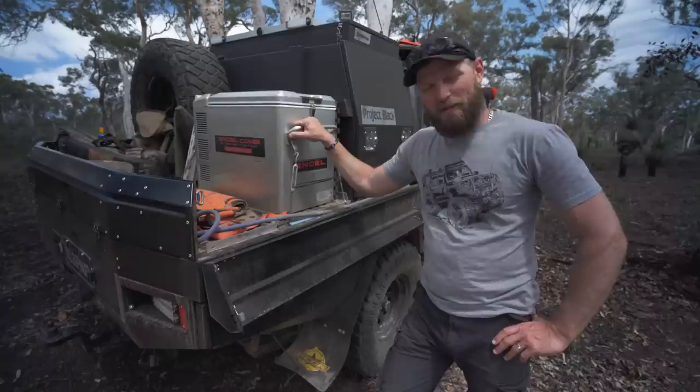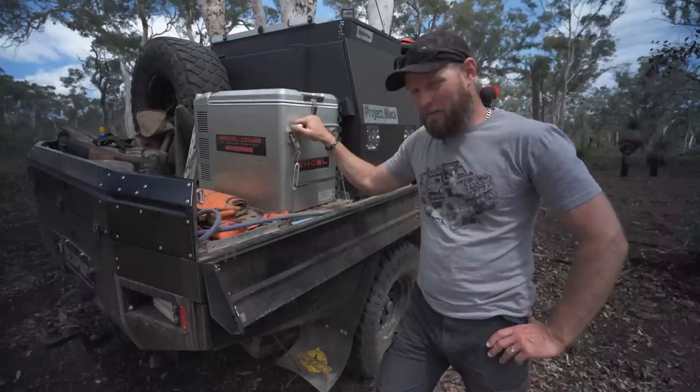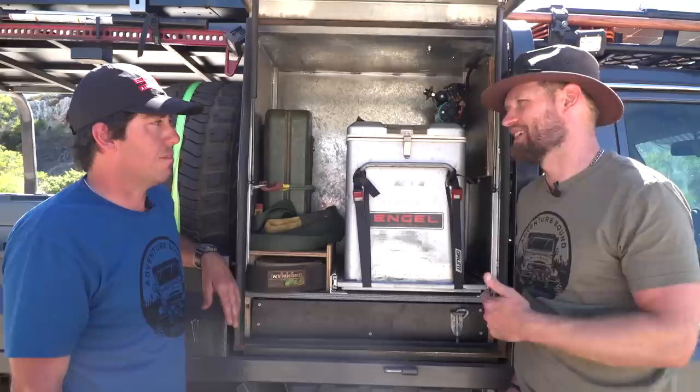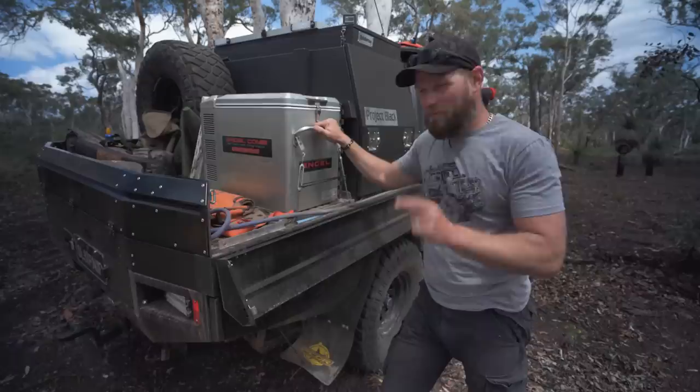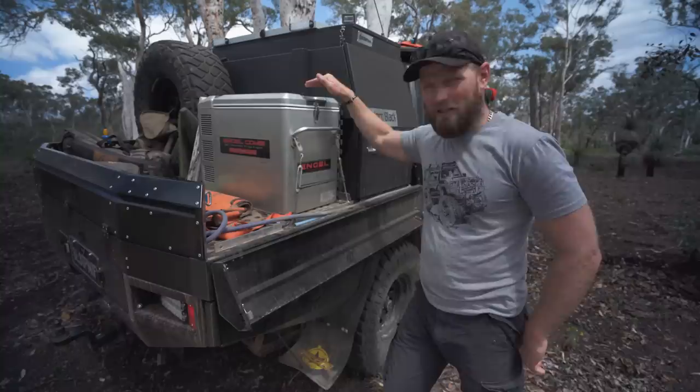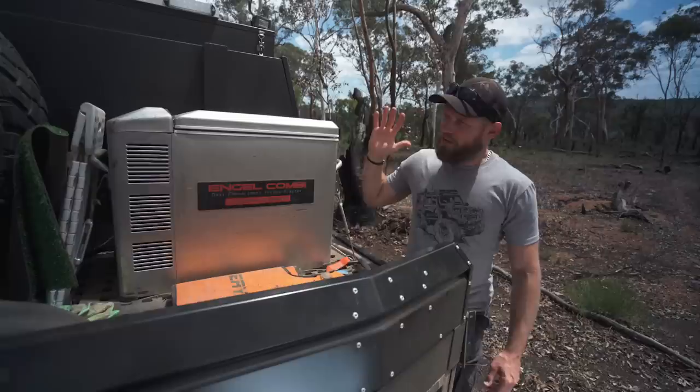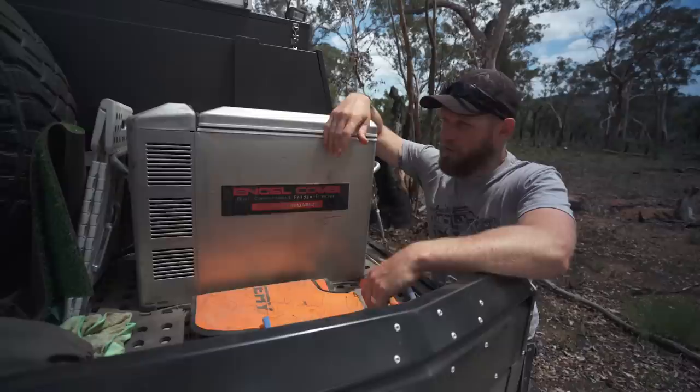The metal casing is worth noting. My mate Wayne de Villers, who frequently travels with us and has Engel fridges as well, had a wiring issue — every time he pulled his Engel out it stopped running, but when he put it back in it ran again. Turns out he didn't wire his earth wire up properly. The fridge was earthing through his canopy because the handle was touching it. So even with a dodgy earth, this thing will still find power if it's touching metal.